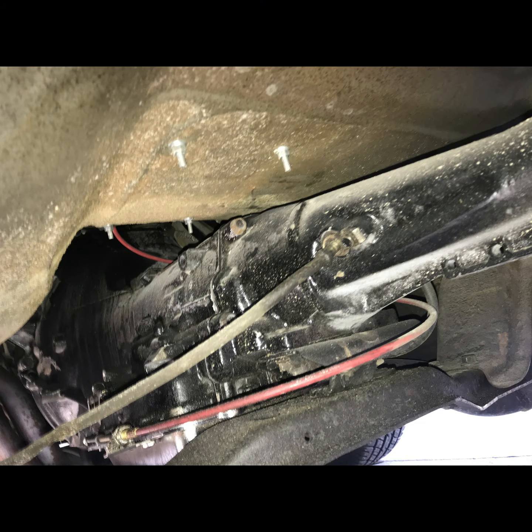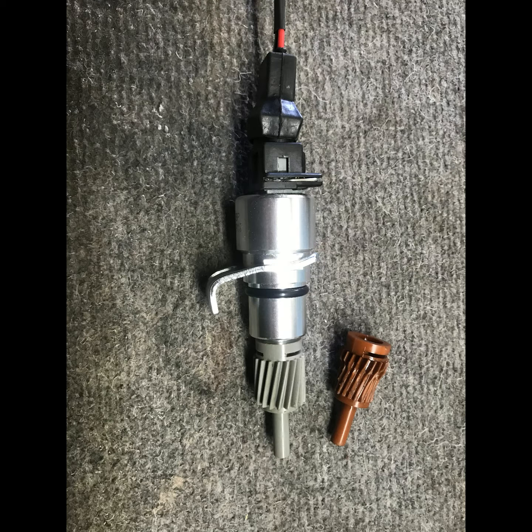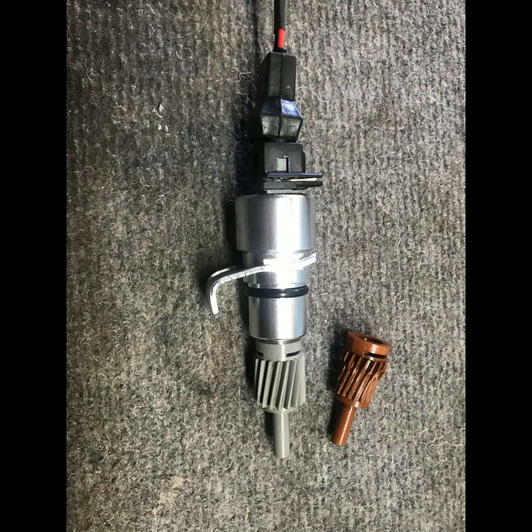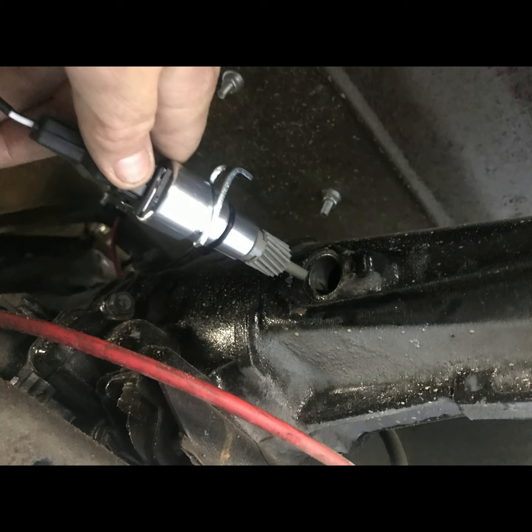Now that the temperature sending unit is done, crawl under the truck and pull the speedometer cable — it just unscrews and pulls straight out. There's a little clip that holds the gear on the speedometer cable; take that off and put it on the sending unit. This little wire plug goes on the back of that sending unit to run the wires to the dash. The red gear I had was fried so I put a new one on, but you just slip it right over the end of the sending unit and put the clip back on. Then install it in the transmission. You may have to tweak the bracket a little bit to get it to fit your transmission exactly right, but it's real simple.